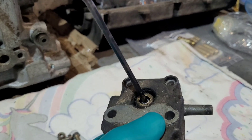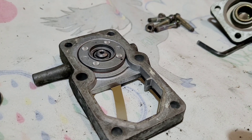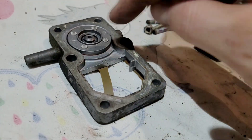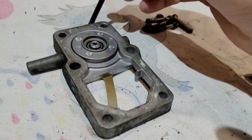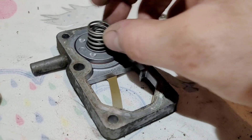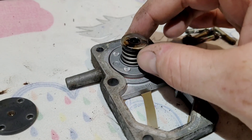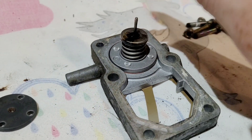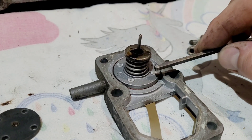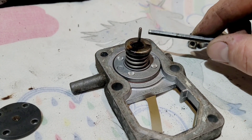We're going to be able to put our allen key through there — it is a 4mm allen key that fits in that adjuster. We've drilled a hole through the back so we can adjust it. The allen key acts on this part, which has a center spring, an outer spring, a little cone hat, and a little push rod. If we screw the allen key in it will raise the height; if we screw it out it will reduce the height.